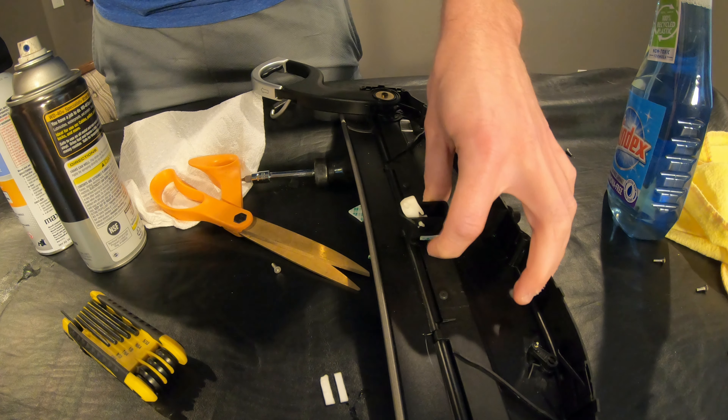So now I'm going to get some measurements for you guys and then bolt it back together and put it in the car. This is the mounting tape I'm using — Scotch one inch — but I cut it down to three-quarter of an inch long, and three-eighths appears to be the right width for the bottom piece. The one on top is smaller — about an eighth wide and roughly a half inch long. I'm going to put it together and see if mounting it makes any difference. I hope we're on the right track.